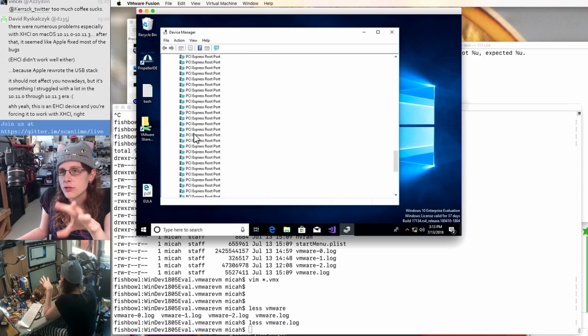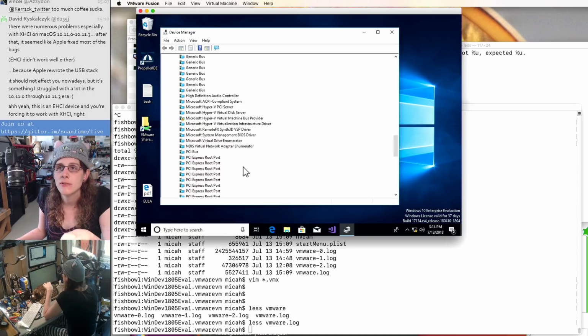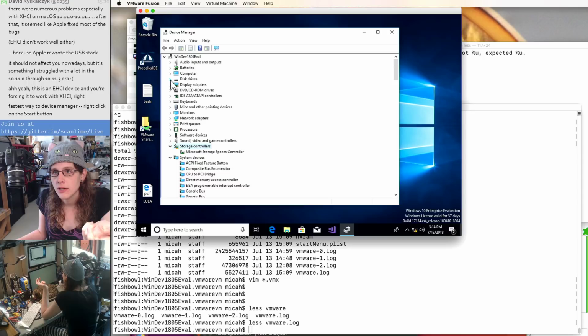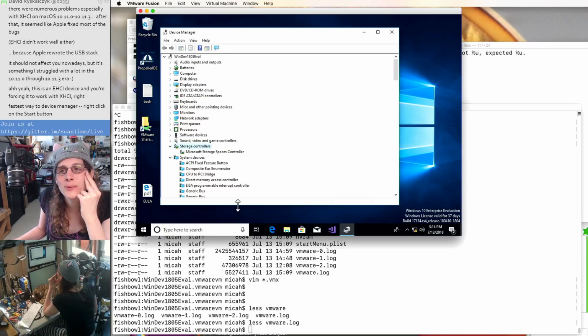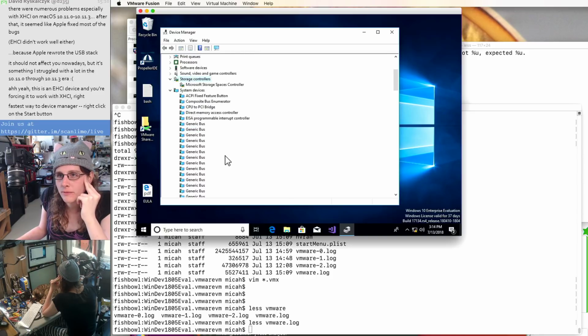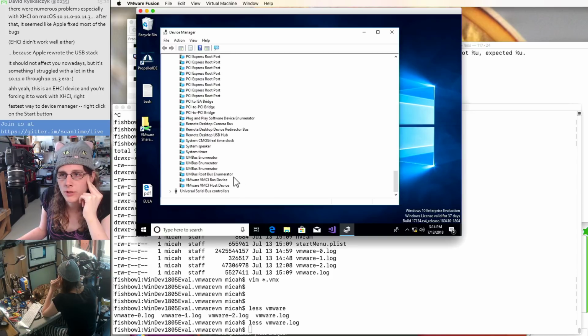Yeah, my hunch here that I'm following by using XHCI is not because that's the way it's supposed to work, it's because I think the XHCI driver is maybe more reliable in particular ways, because XHCI is just an easier host controller to virtualize. Virtualizing isochronous transfers specifically on any of the other kinds of controllers is just a huge hack. I tried to do a really good job at it, and it usually works, but it's fundamentally a hack the way it has to work. It involves kind of looking into the future and trying to figure out when packets actually show up in the schedule ahead of when the real hardware would be able to notice them, usually.